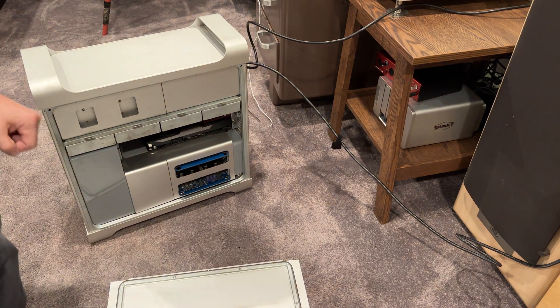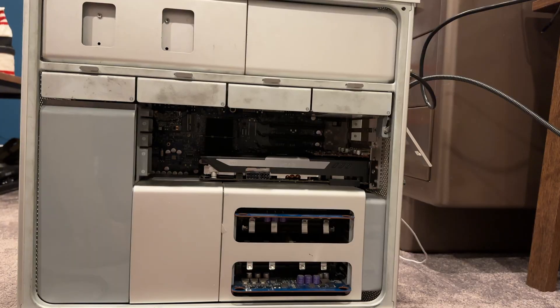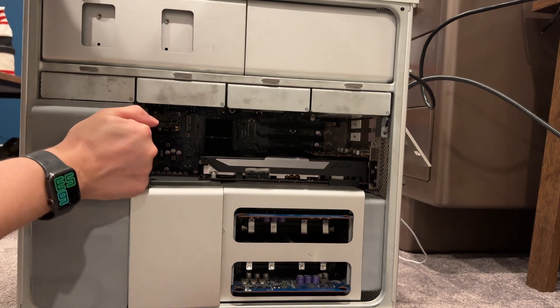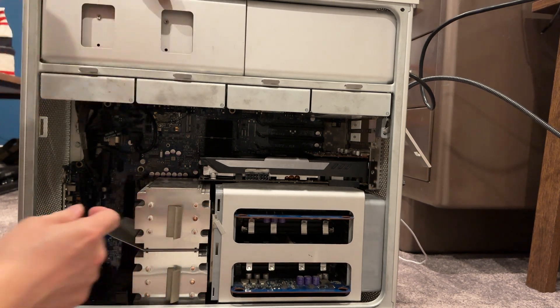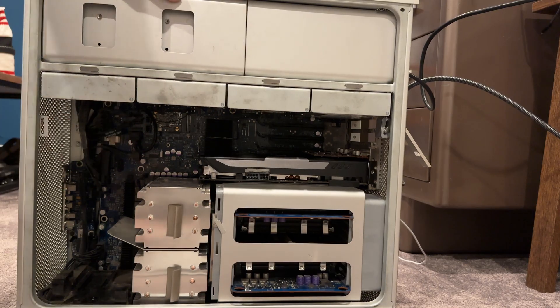My Mac Pro 2008 has some quirks after many years. One of them is that I lost the screw that secures the fan chassis — so pro tip, just don't yank on the fan chassis unless you've already removed the screw. On the topic of wireless chipsets, I upgraded the airport card in this computer to an AC model, which is supported in the latest versions of macOS. If you'd like wireless networking support, you'll need to upgrade your chipset to one supported by the latest macOS — you can read more about that in the definitive Mac Pro upgrade guide, linked in the description.